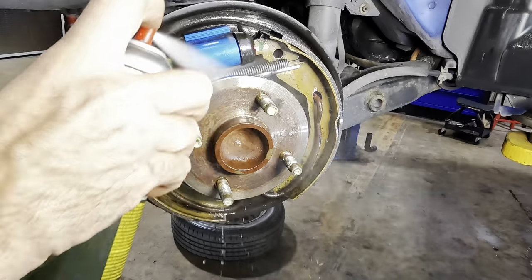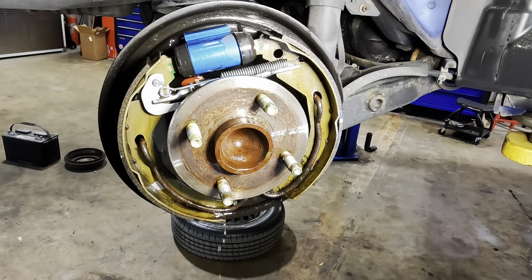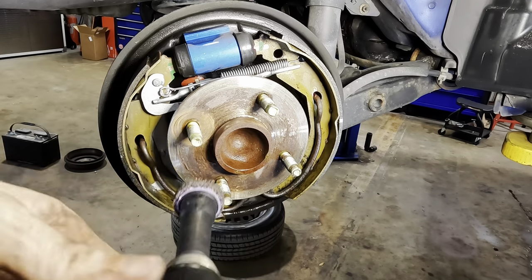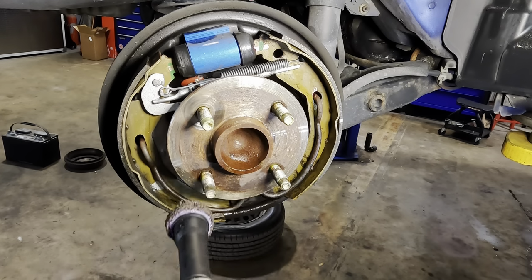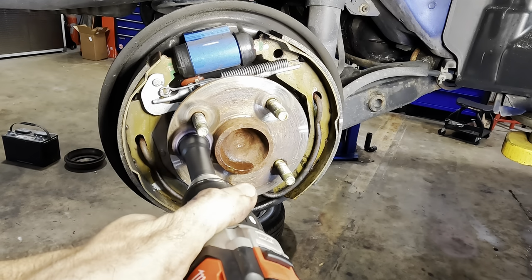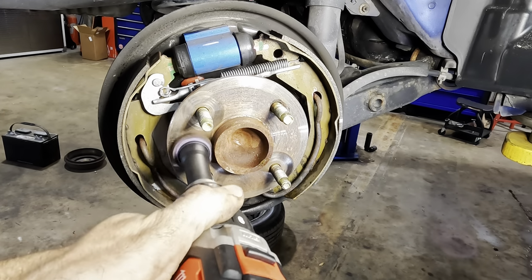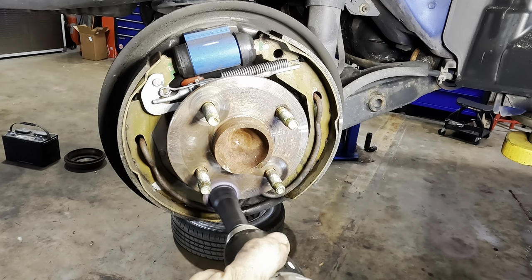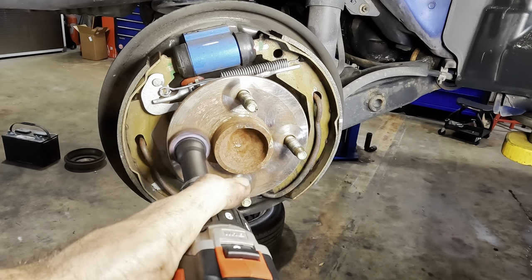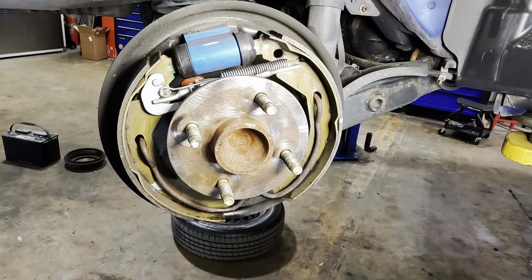Get behind the shoes, on the bearings, all the adjusters. Good. Let's polish off some of this rust right here. Got a little abrasive bit. It has a hole in the middle to go over the studs, for maximum contact. Shiny. There we go. Okay, that's successfully been de-rusted. Round two.